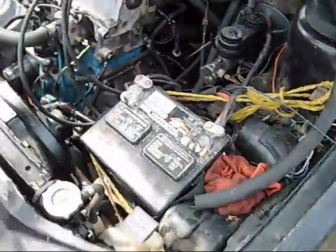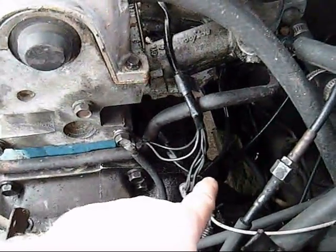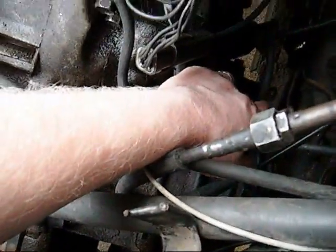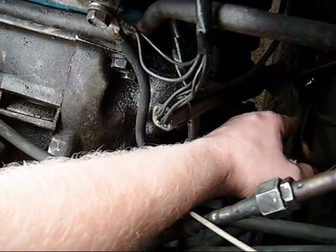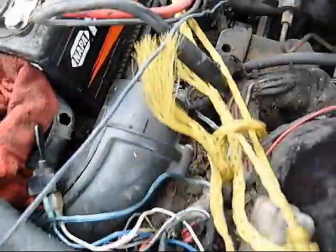This Shadow is an '89, so it had a cable-driven speedometer and has a speed sensor in the transmission for the cruise control. Not all vehicles have an electric speed sensor - some have a sensor but it's not plugged into anything. If you have a cable-driven speedometer vehicle, look down at the transmission where the speedo cable goes - there should be an electric connector right next to it. Vehicles without a cable speedometer just have the wire and connector. That connector has two to three wires and it's pretty much the same on all Dodge vehicles - white with orange stripe - so I just tapped it in there.